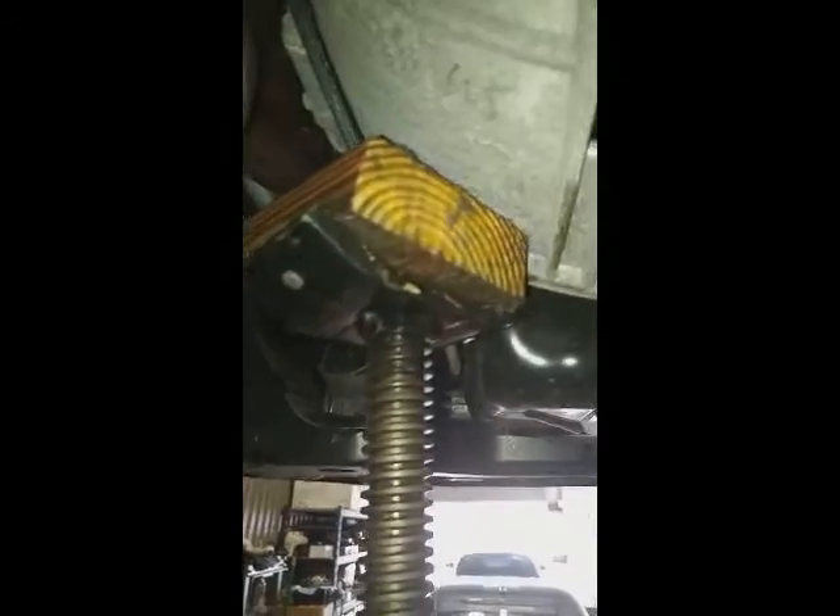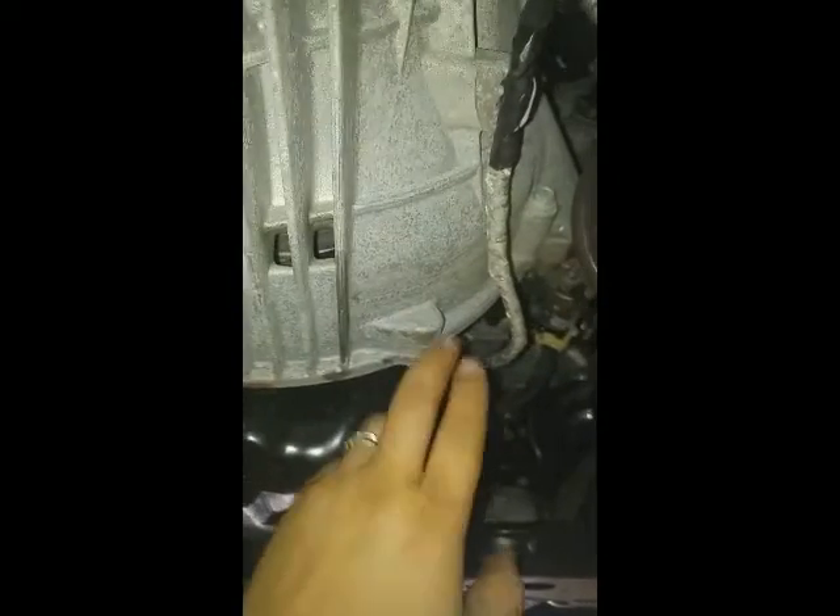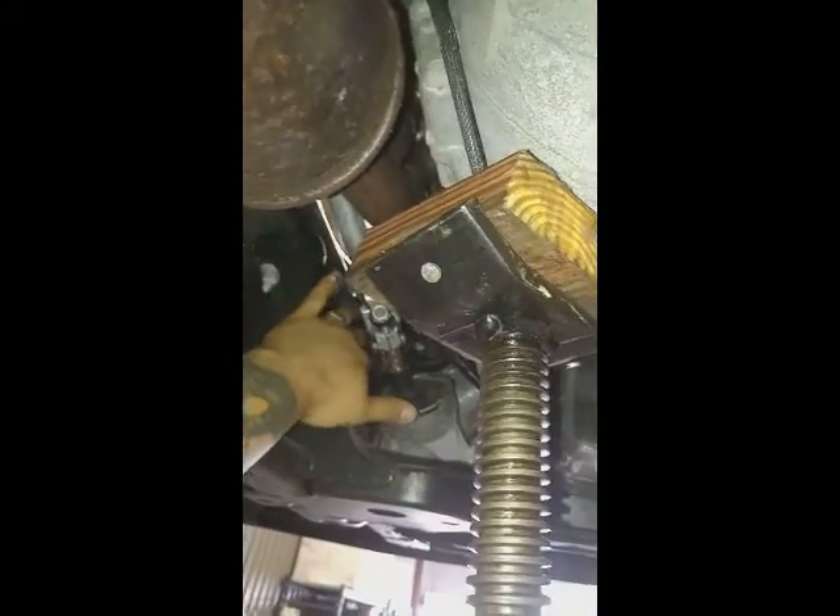We're in place on the driver's side here. And you can see there's plenty of room there. I've got it lifted up. Again, we've already removed the factory mounts, but just to give you an idea of placement. Again, if you don't have a pole jack, you would lift here at the same location with a floor jack, and then on the other side here on these little ears. Again, it's one side at a time. If you try to lift the whole thing up, you'll have a more difficult time getting the mounts out to clear the subframe. So do one side at a time.